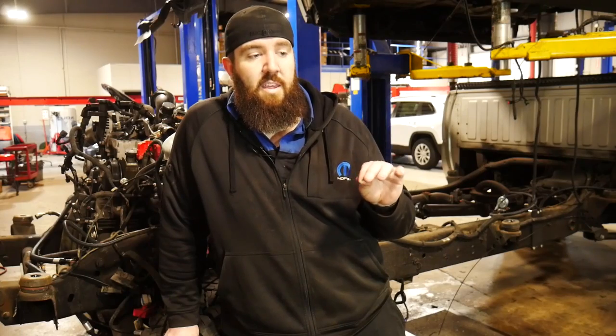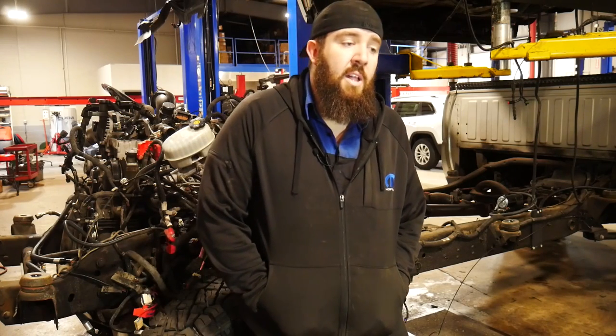We're going to get these packaged up and shipped off to Bitterroot Diesel out in Montana. These guys are the pros — I've done quite a bit of research on them. We're not going stock and doing a quick rebuild. We're doing 60 overs — a full rebuild with new seals and new jets. They're going to check solenoid pressures and run flow bench tests putting 24,000 PSI fully through them. Plus they'll run an idle test to make sure the injectors aren't putting out too much fuel at idle.